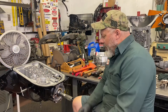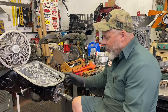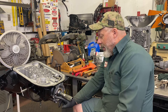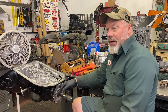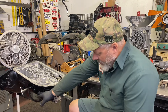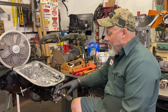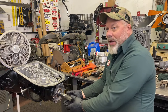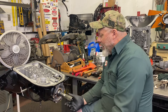There are two seals at the rear. One is around the output shaft — it has a snap ring that holds it in, easy to change. And then there's this cup over here with an O-ring on it. This actually seals to the tail housing and provides oil for the rear bushing. There's a passage in the tail housing — this is known as a solid shaft. If you have the spread cooler lines, you have the solid shaft and you need pressurized lubrication. It works really well. The bushing back here is typically in good shape because instead of just relying on splash oiling, now it's actually pressurized oil.